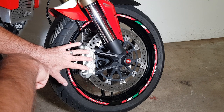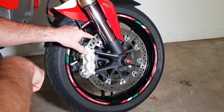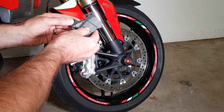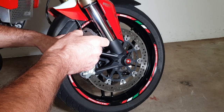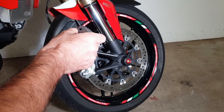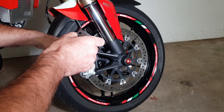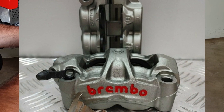What you want is a balance of all four pistons moving in and out uniformly at the same time. If you can get the calipers clean and free, pistons moving freely and uniformly, brake discs clean with no contaminants, and brake pads in good condition — ideally fit new ones — it will make a big difference to the front brakes. These are the standard Brembo Ducati OEM pads. There is a limit to what this setup can cope with. If you ride really hard, you eventually get a wooden feeling from the front brake where no matter how hard you pull the lever there's nothing more to come.